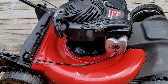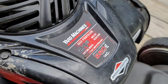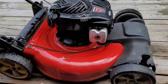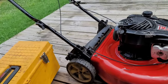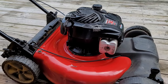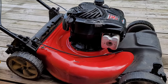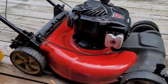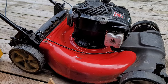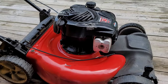What's going on YouTube. Today we're going to do a little project on a 21-inch Yard Machine lawnmower. Somebody sat it out in the garbage - I went by one rainy day, saw this thing sitting outside with a sign on the push bar saying 'free, take if you can get it running.' So I threw it in the back of my truck. A couple weeks ago I cleaned out the carburetor, cleaned out the air filter because it was clogged, changed the plug, did a few odds and ends to it, and got it started right up.